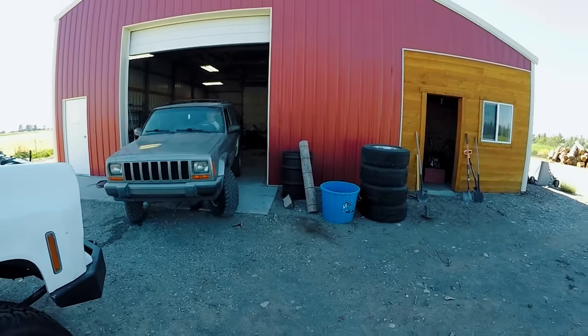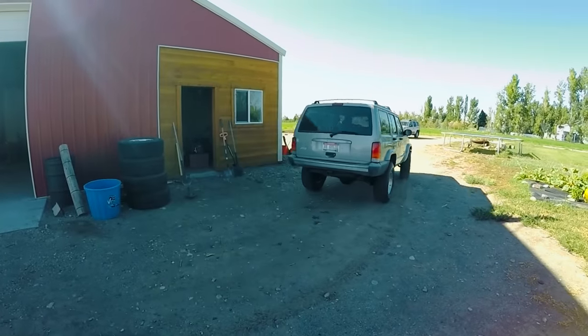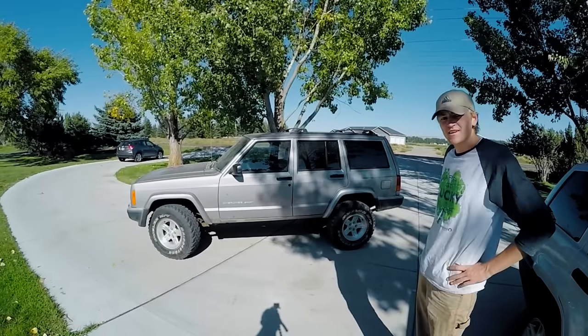He had fun driving it off-road, he had fun driving it around town, and then he started to have overheating issues. I think it had a bad heater core and was slowly losing fluid, and unfortunately that engine got overheated multiple times. And eventually, I'm pretty sure we cracked the head in this thing. That was really common in like 2000 and 2001 on these. So they usually crack right under the oil filler cap.